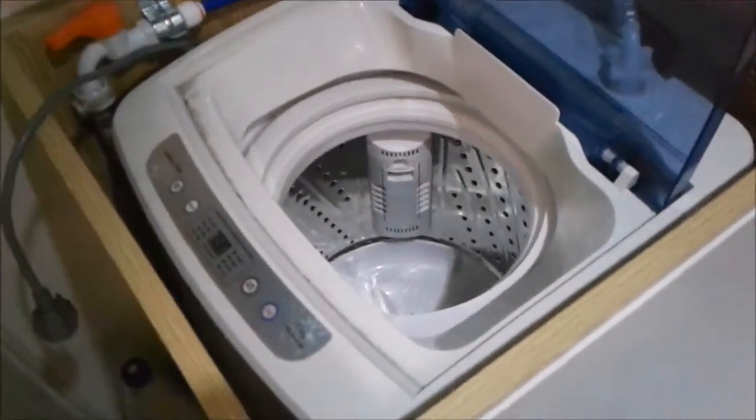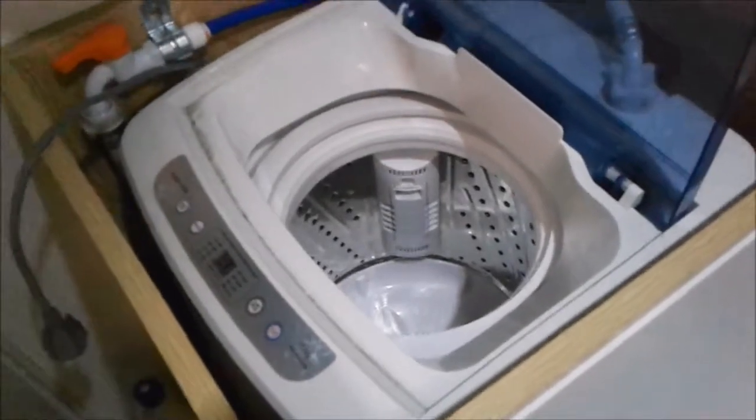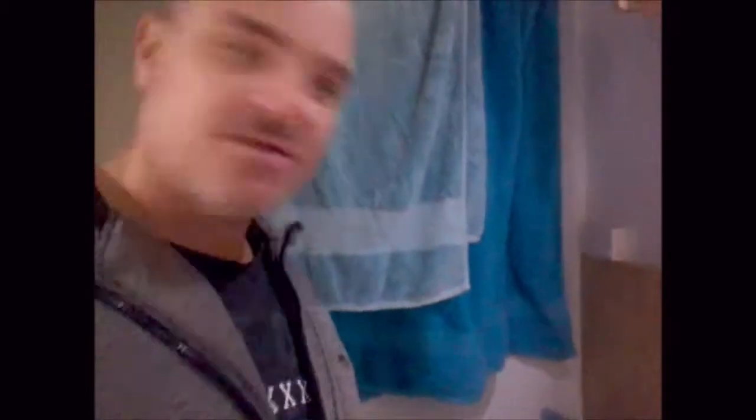It's really designed for use in caravan parks, not off-grid. The washing machine will use about 35 litres of water for each cycle. It'll first go through a wash cycle — fill up with 35 litres, go through its agitation cycle, then drain out. It'll then fill up with a rinse cycle — that's another 35 litres — drain that out, spin dry, and your clothes are done. So you get 3.2 kilos of clothes done for 70 litres of water.